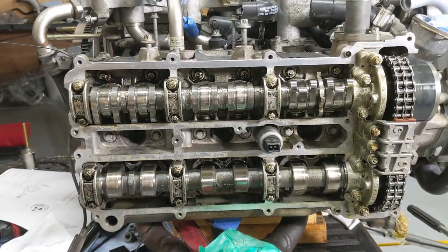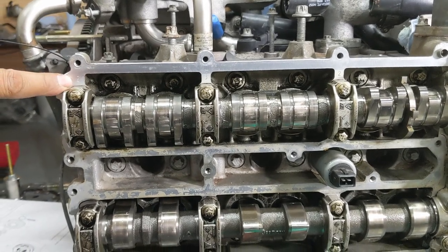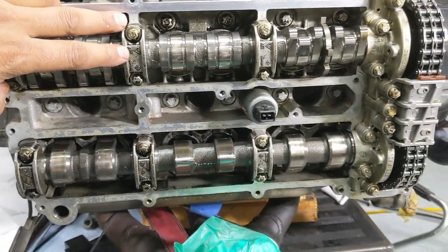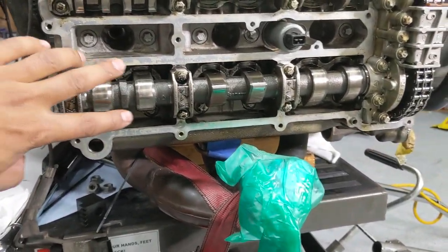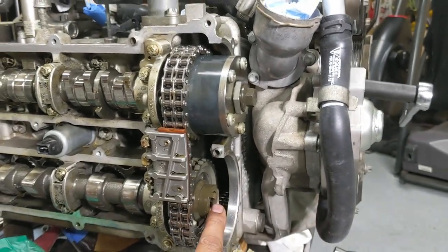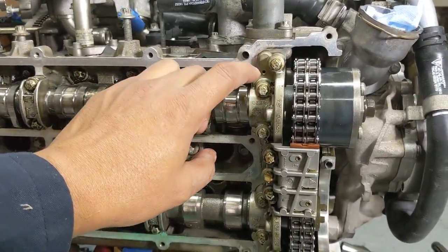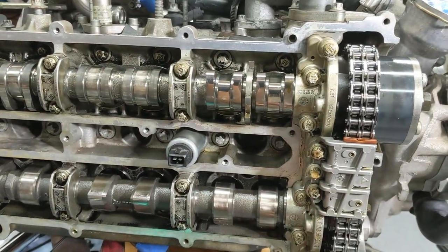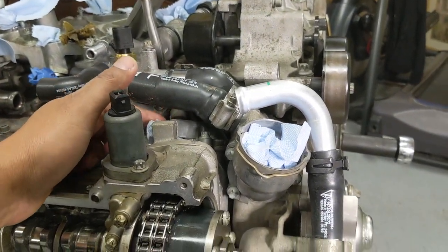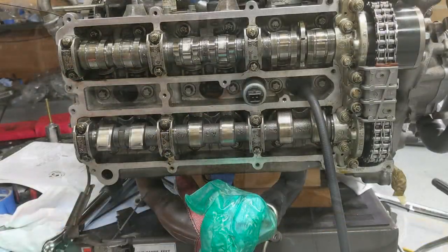About to pull off the camshafts from the engine. These little brackets are numbered to match the stamping on the head - so this is four, three, two, one and this is seven, six, five. The thing that's got to come off is the two sprocket screws, one here and one here, and the actual pinning part happens inside here, so these bolts also come off. The tensioner up here is the one that's going to come out and get replaced, and then these blades that guide the chain top and bottom will come out.